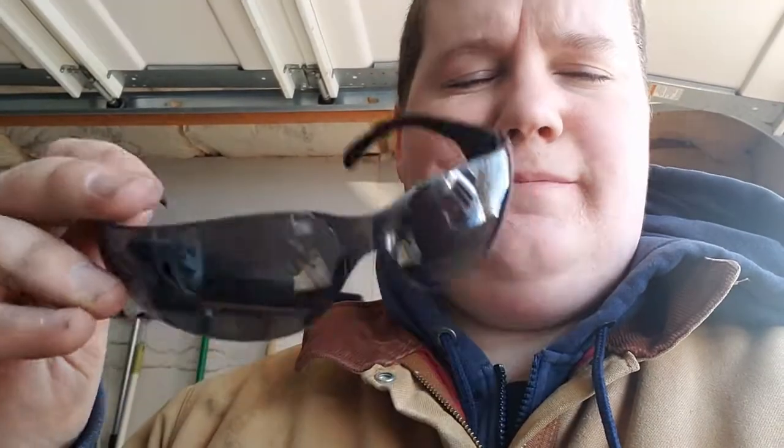To clean that off, I'm going to be using an angle grinder with a grinding wheel on it. I just wanted to take a minute and remind everybody to use safety equipment when dealing with power tools. Always wear, at minimum, safety glasses — these ones are shaded and OSHA certified. It doesn't matter if they're clear, shaded, red tint, or blue tint — just make sure they're OSHA. Always wear work gloves. If you're using a cutoff wheel, I recommend using welding gloves and definitely use a face shield. A couple years back I had the safety glasses and gloves, but not a face shield, and the cutoff wheel kicked back — you can see this gnarly scar I have. Highly recommend using a face shield when using a cutoff wheel. It was not a fun experience. PSA over — use your safety equipment.